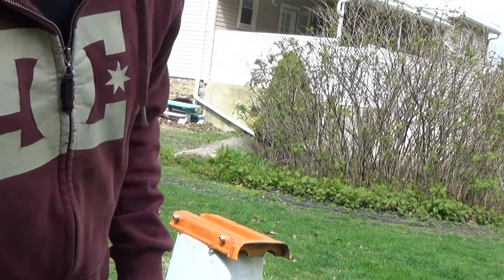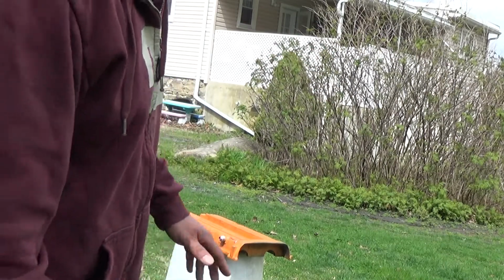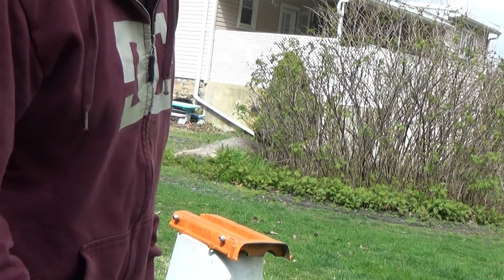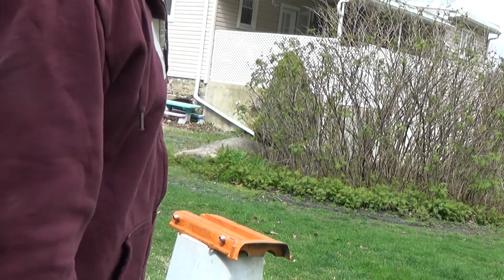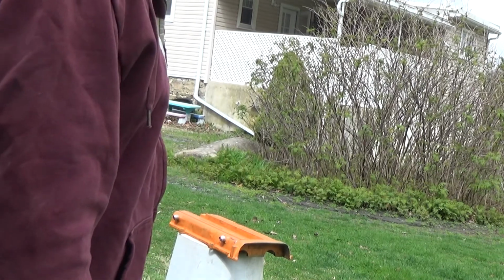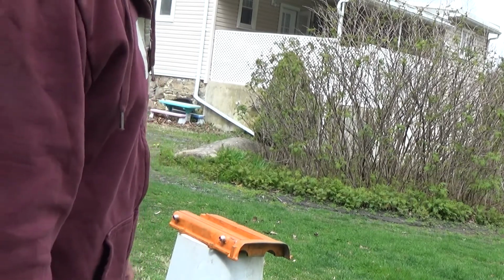To do the outside, same thing. I'm going to spray from the top and let it drain down. With this high temp paint, a lot of times the paint will just come right off with brake clean, which is perfectly fine. You know, this is not a show car or anything. I'm just freshening it up. And my main goal is just to get all the oil and grease off of it.